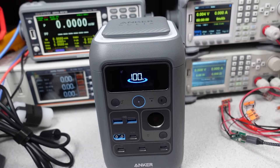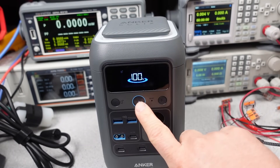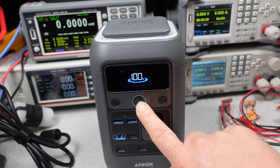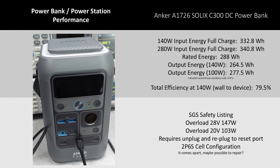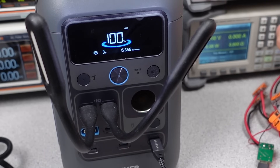It has all these features, but is it any good? Well, it's near the top for power banks. It's not the best by any means, but it's not bad. The energy in is about 330 watt hours. If you charge faster, it gets a little less efficient. Same goes for discharging. At 100 watts out, which is probably not an unrealistic continuous load for a couple devices plugged in, this gains almost an extra whole phone charge. So it can be even better if you slow charge things, but not too slow — it takes power to keep everything awake.